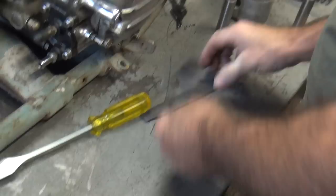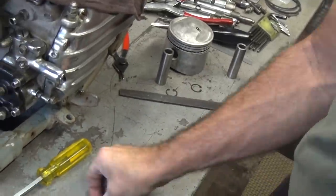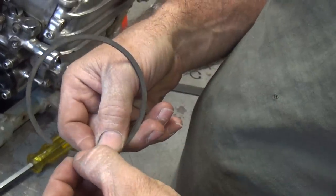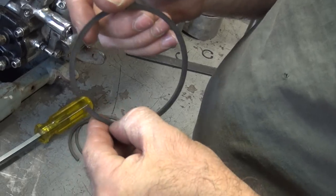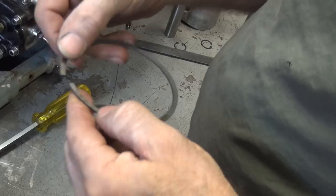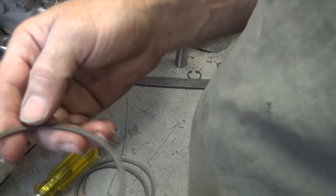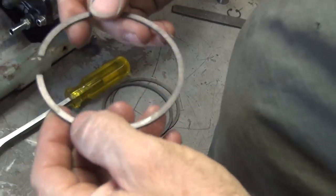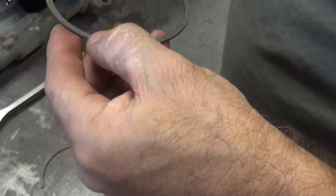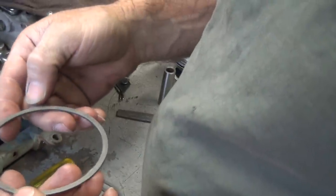So we've got two rings for that one and two rings for this one. Now let's see if the rings are all the same. These are pressure backed. These are all pressure backed rings. So we look for any kind of marking — of course there are none. Why wouldn't they mark them? It tells you which way they're supposed to go in from the factory. Otherwise they have a 50% chance of getting it wrong — or right. It's 100% chance of being wrong, 50% chance of being right.